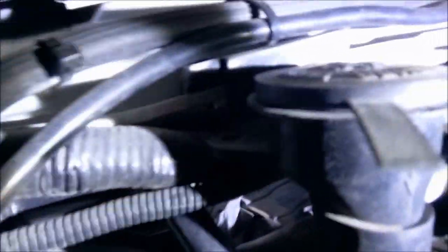I mean, it looks like at least a 1-inch gap, right? I mean, that's a good 1-inch gap, at least a 3/4 inch gap. So how are we going to seal that up all the way around, even into the back? Look, you can see a gasket back there too, back by the firewall. I imagine a lot of that trash got thrown into the blower motor at one time and caused the blower motor to wobble, the wheel to wobble.